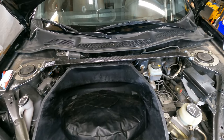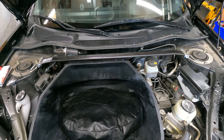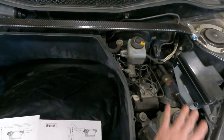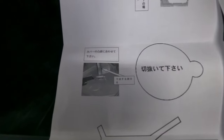There is a guy reproducing the TRD braces and that wasn't available when I ordered these. Had it been, I probably would have gone that route, so I'll put a link to his in the description too. I forgot to mention that the frunk plastics that cover all of this have to be removed to put the strut bar on, but they do give you a template to trim them so you can put them back after you install the strut bar.